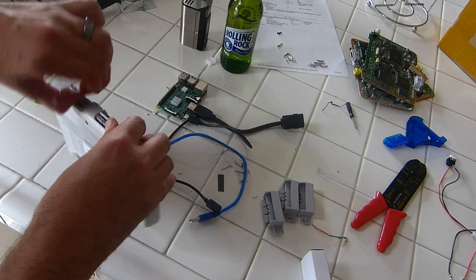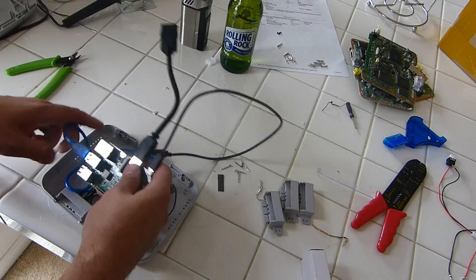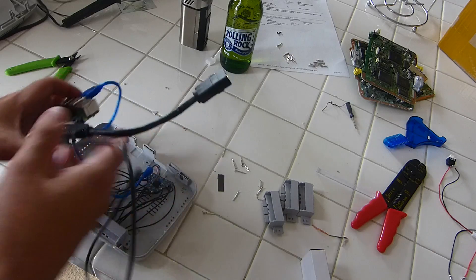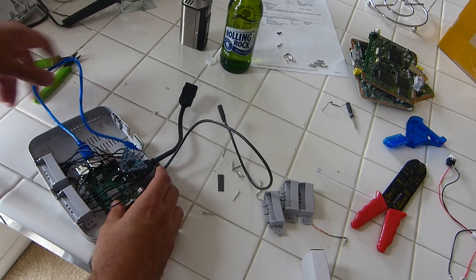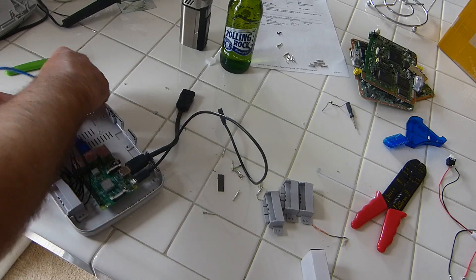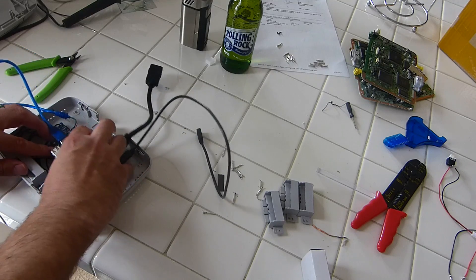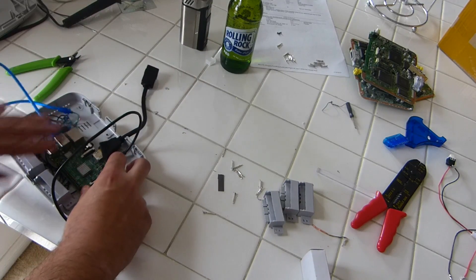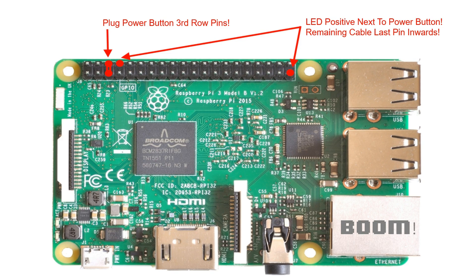It's not that hard to get them perfectly aligned. If you get a little excess hot glue in one of those holes, as long as it's still aligned you can still get your screw back in — just be careful. Here I'm laying things out to see where I'm going to put the Pi in this case. I'm using extensions for the HDMI and a power cord extension, which was really important because I didn't want the power cord permanently attached — I wanted to be able to unplug and remove the system whenever I chose.